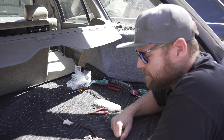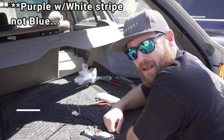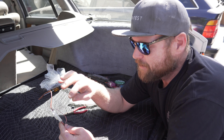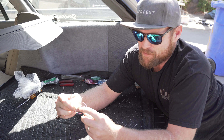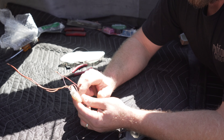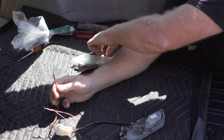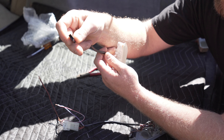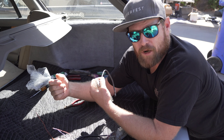What you're going to do is actually flip it over and look to see which one you have. If you have the blue wire, you'll notice that. I'm extremely colorblind, so I can give you the colorblind basics: if you look at this connector here, the outer two wires are the grounds, which are brown, and the middle one is the power wire. Then what we're going to do is connect this power wire from the connector's power wire, hook the two grounds up, and cut this receiver — the female piece — in here. We're going to attach that and put little connectors and tape it all up and get it going.